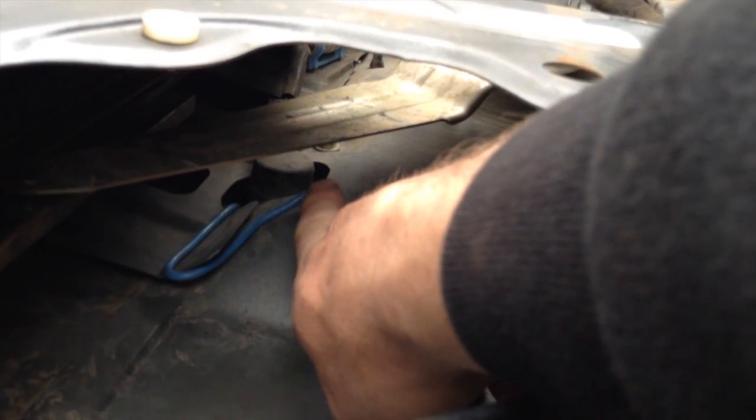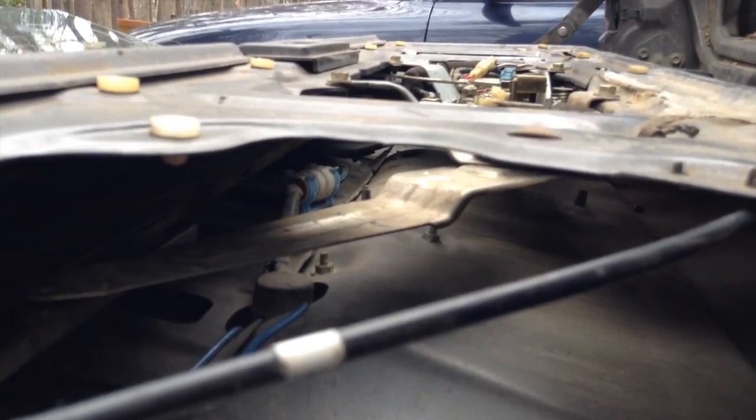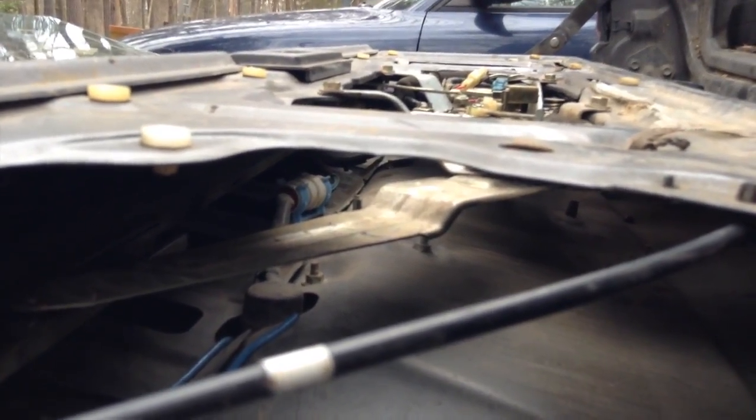And so what I had to do was figure out why it was popped out, and I saw this piece of metal right here. This flat piece of metal was sort of separated and flapping up, so I took a piece of wire and I made a little clamp that clamps those two pieces of metal together, and that allowed for that switch connector to go down about 1/4 of an inch and clear the clearance of the window. I don't know why it does that, but you can see that it left a streak right here, and that's what that streak is on my window.